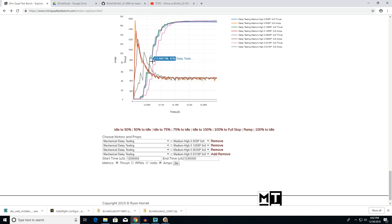It's about eight milliseconds. That's not nothing, but it's not dramatic either. The prop is taking around 120 milliseconds to get to RPM total, so it's maybe 5 to 10% slower — that's like 160 milliseconds at the extreme. So you definitely want to err on the high side; otherwise you're going to be hurting your performance for very little gain.